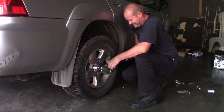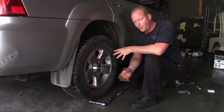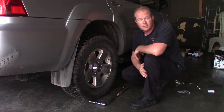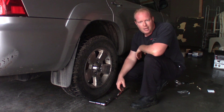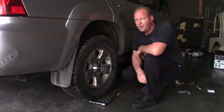Now that I have the sensor programmed to the ID the car thought it already had, I'm going to stick it in the tire, air it up to the correct pressure, and ship it — it'll be all set to go. And this time I'm going to make sure that some random person doesn't put the wrong valve cap on it. That's the simple process of replacing a TPMS sensor with an Autel One Sensor using the TS-401. Now I'm going to go check the rest of the pressure, and that's one less thing she has to yell at me about. We'll catch you next time — make sure you give me a thumbs up and subscribe to the channel. Plenty more to come.